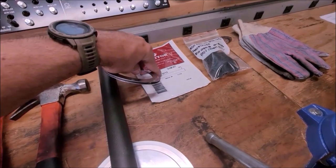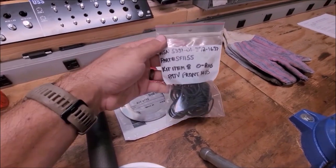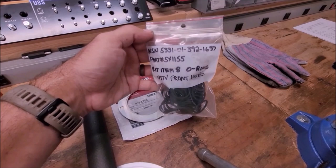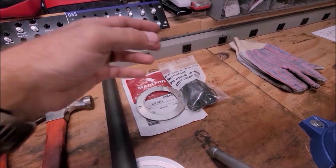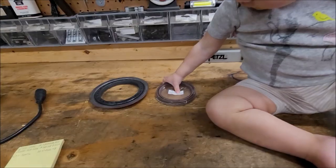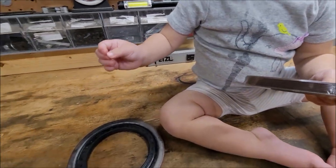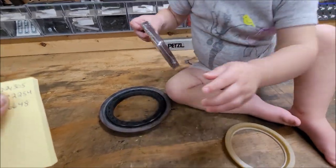The bigger one being for the seal that's on the backside of the hub, for the bearing, and using this one for the CTIS seals. And this is the driver that comes with it — links in the description. Shim kits for the axles, kit 4715. Part number 5X1155, NSN 5331-01-392-1637. These are the O-rings that go on all four of the gear at the end of the axle — you have to replace those. Forgot to record a clip with the seals and the part numbers. The CTIS seal part number is A1205Q24305.